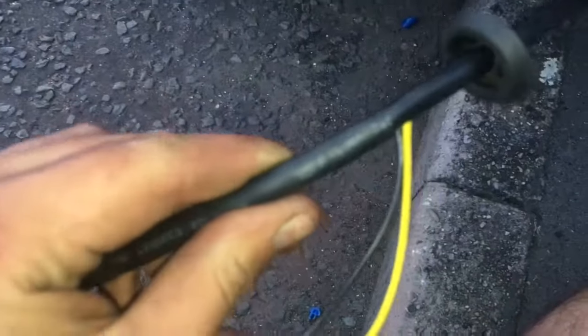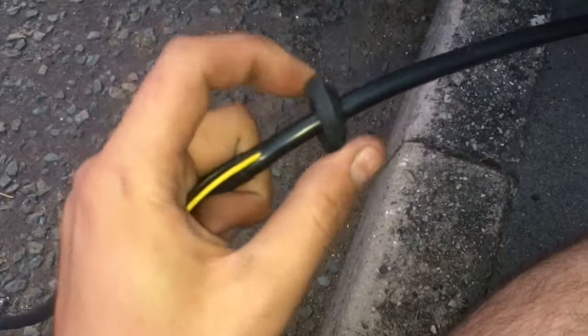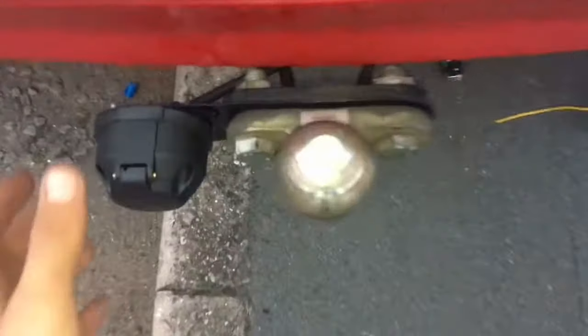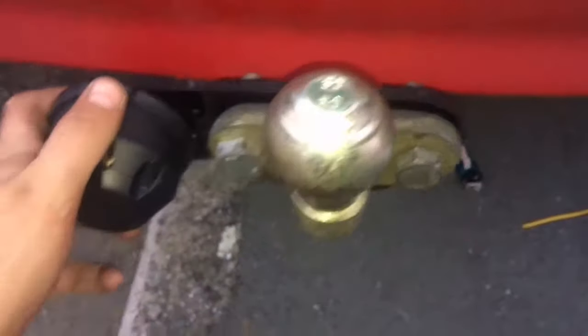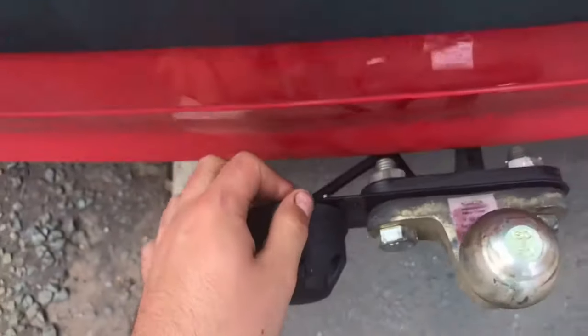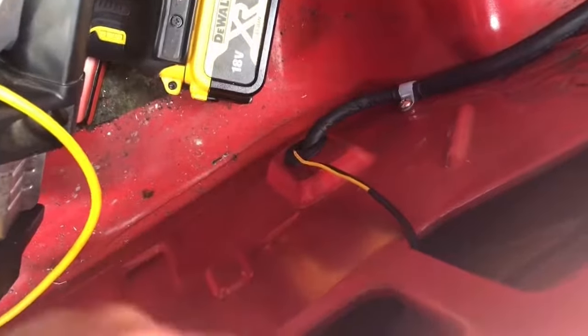I've sealed the main wire all back up, shrink wrapped it - nice and watertight. Here's our grommet where it goes through the floor and the boot. This is our hitch and our electrical supply. The hitch side is all done with. The plug came pre-wired, so the wires are on the opposite end. I've poked through this grommet and routed the left hand wires up and over into the rear valance.